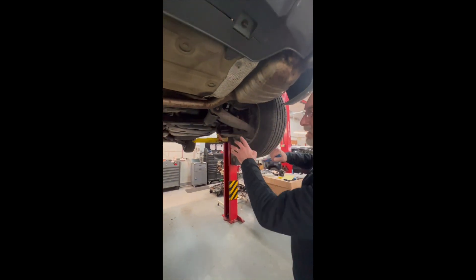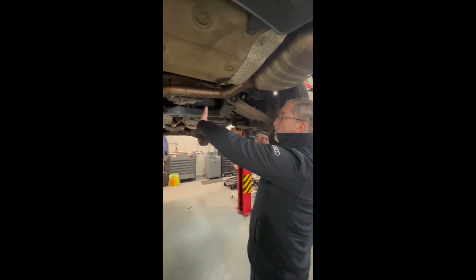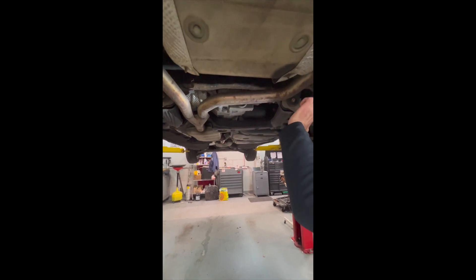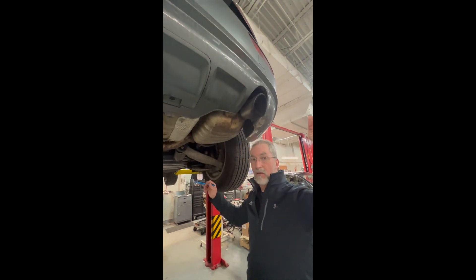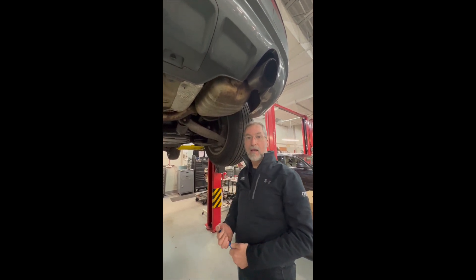The front is similar but shaped differently. Moving on to other things, we have a rear differential — this car being a quattro all-wheel drive. We check this for oil leaks and fluid level. Right next to it is the exhaust pipe, which gets the exhaust from the front of the car to a safe exit at the rear. If you have any leaks in there, they need to be taken care of straight away so as not to asphyxiate the passengers.